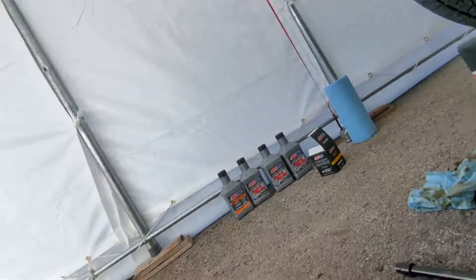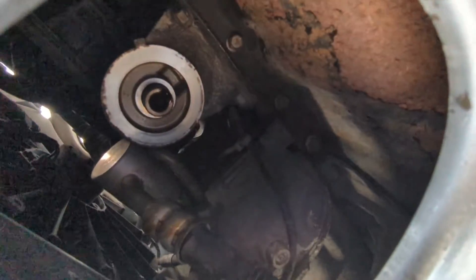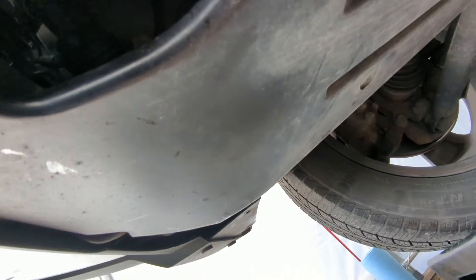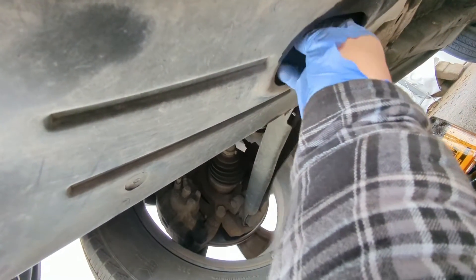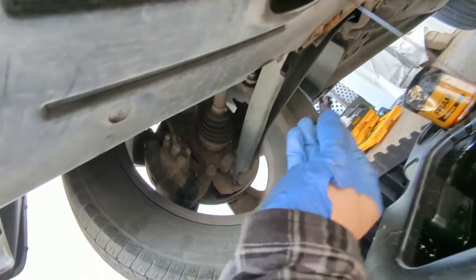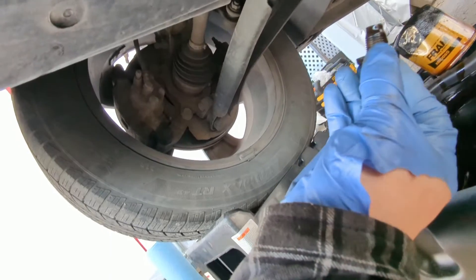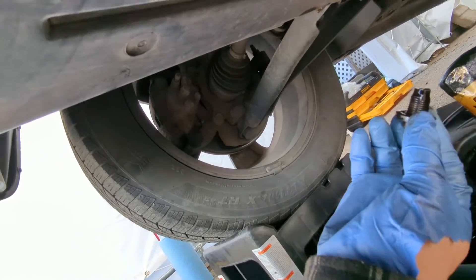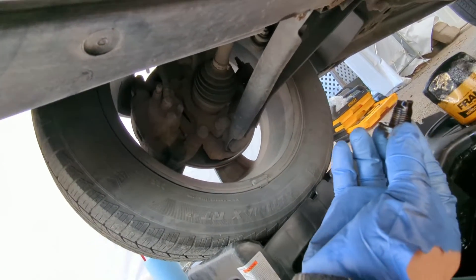So I got everything removed here. You want to make sure that's where the filter goes. Shop rag down and make sure everything's nice and clean — get all the dirt out of the edges here, because that's where the rubber will make the seal. Once I have everything out, I'll always double check. Make sure whatever oil pools up once you put the plug back, it kind of pools back up here. Clean out the plug, make sure the rubber is nice and clean, and plug everything back up. Put the filter back and we'll be adding in the oil.